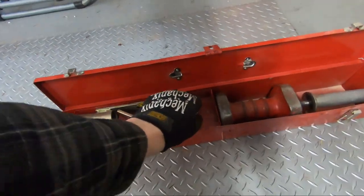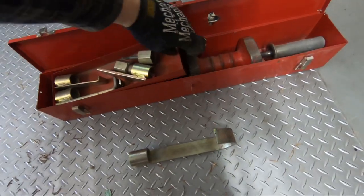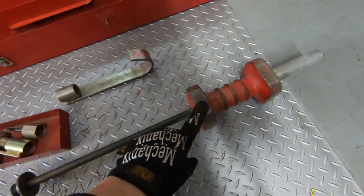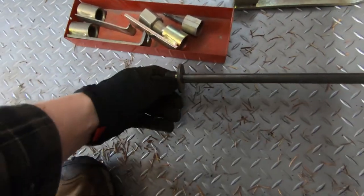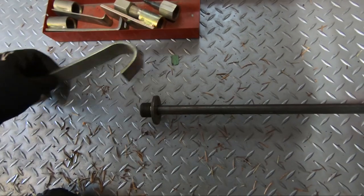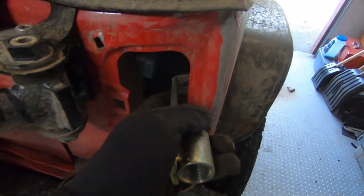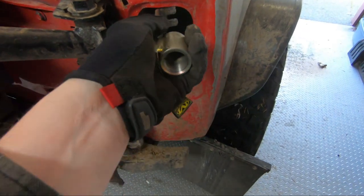What I'm going to use to try to get this dent out is a slide hammer. I borrowed one from a friend but I've never actually used one before. I can see how it would help with pulling that dent out because you need to hit it with some sort of force from behind, and that's what the slide hammer does. Here's what it looks like — it's got some hook attachments, a very heavy ram on it, and an end where you can put various attachments. Probably this hook or maybe the smaller hook. What we want to do is get this in behind here and use the slide hammer to pull this back out.